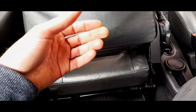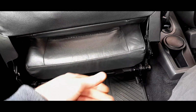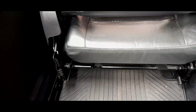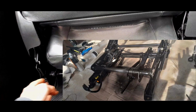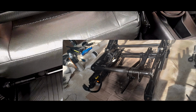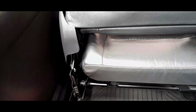Obviously, they're not going to rot to the point where they actually need replacement, but they look really scabby and really nasty. And when you're refurbishing a seat, I would recommend going around with some rust killer and some fresh satin black is what I used. And it looks really appropriate. And it's still got some overspray of zinc primer, which I did put down in some areas. But it's nice to make it look good. And obviously GT85 along the runners.